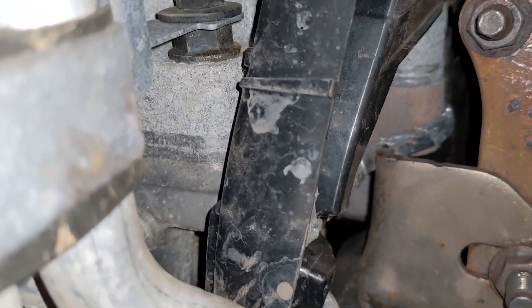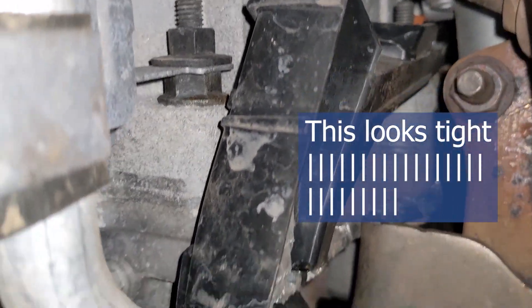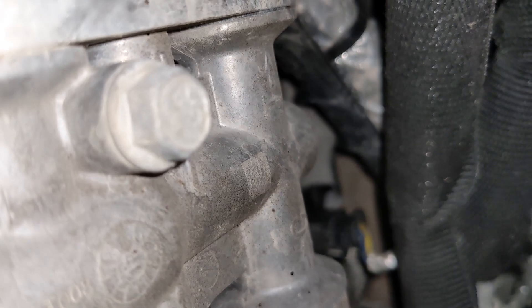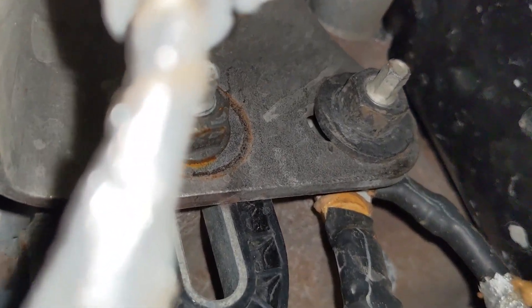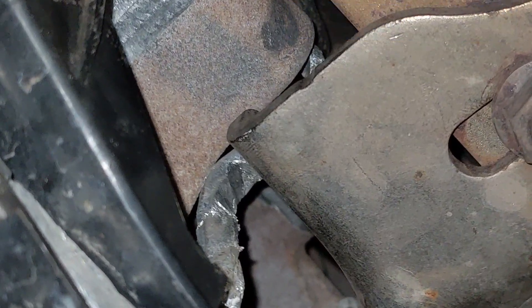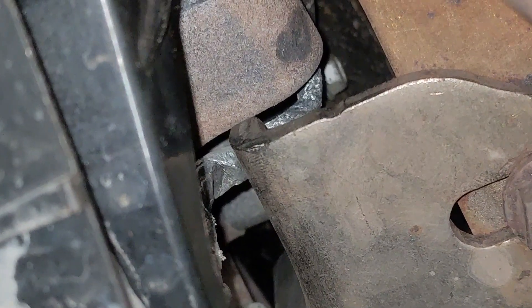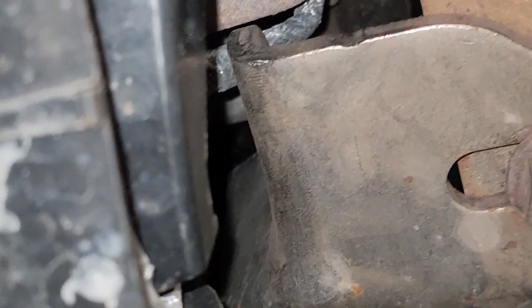After receiving the truck back — it took about three weeks for them to get everything fixed — they had replaced a bolt in the exhaust. I decided to get under there and take a look. I noticed one wire that looked really taut, so I ended up moving that wire. This was basically an inspection of all the different spots to figure out which bolts had been replaced. After I moved it, there's a witness mark on the metal where the wire was, and also a witness mark where it was up against a bracket on the exhaust. Moving it tended to relieve a pressure point I was concerned about.